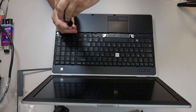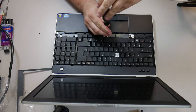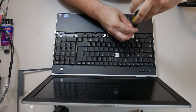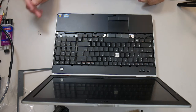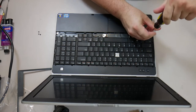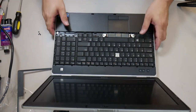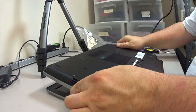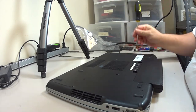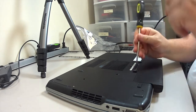Now, oddly enough, these keyboards have a bunch of holes that look like screws should go through them, but there's really only, I think, three screws on this keyboard, even though there are about five or six holes. So it helps to memorize where the screws came out of the keyboard whenever you take the old one out. And this is me spinning a screwdriver. It's riveting entertainment. Yeah, I'm surprised this isn't on primetime television. See? These people who designed this stuff, they have screws that shoot through the back and into the bottom of the keyboard. I think this one has three.